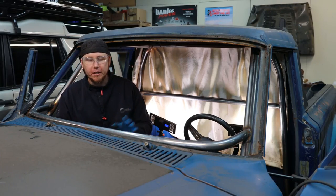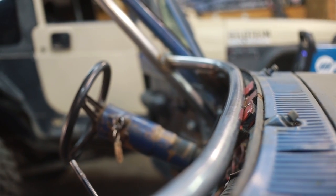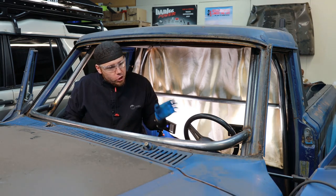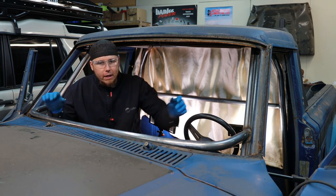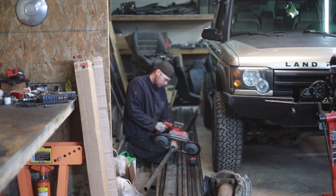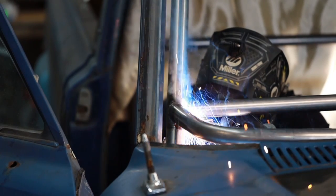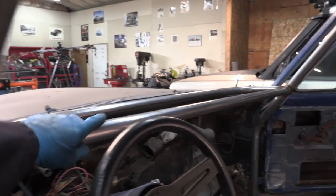That was pretty time-consuming and a little bit tricky, but I was able to do it all in one shot. There are a lot of funky angles here, but I think that overall it looks the way I wanted it to. I'm happy with it - happy enough to move on to the next step. The next step is going to be adding a straight bar across here, going from one joint to the other, which should be relatively simple, and then we're going to build a bar that goes underneath the dash. If you're building a cage from scratch, I highly recommend referencing the NHRA drag spec and the Ultra Four spec when designing it. You don't necessarily need to adhere perfectly to these guidelines, but there are great nuggets of information to make sure an aesthetic cage can also meet some basic safety requirements. Some cage is definitely better than no cage.